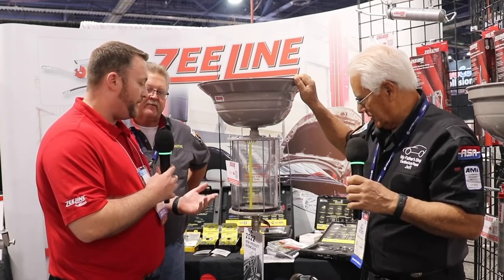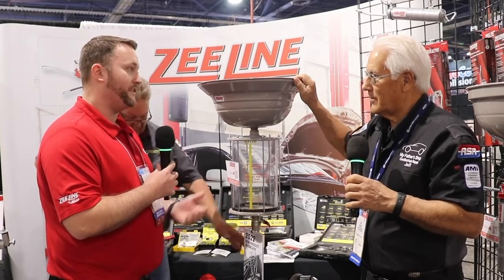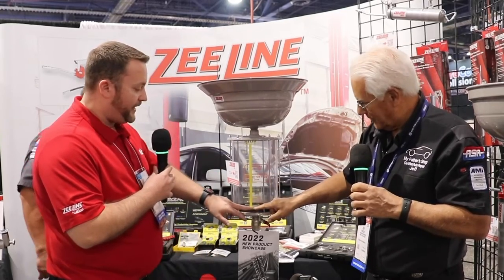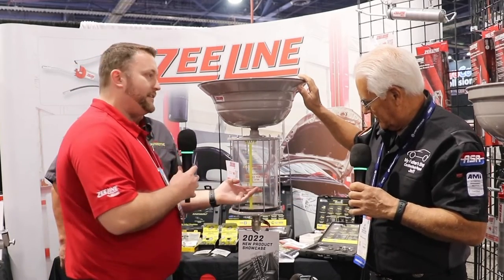So what's important about this one — when you run into mostly the Toyota and Lexus category, even some newer Fords and Chevys are coming out with trucks now with no dipstick tubes. Most of the refill procedures state to the technician to refill the transmission with what you took out. So this has a 9.5 quart bowl, it'll feature every tick mark there for 1, 2, 3, 4, etc. You'll be able to measure out the contents that came out of it.